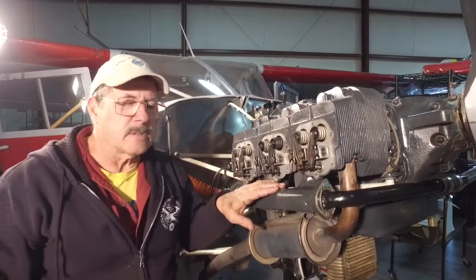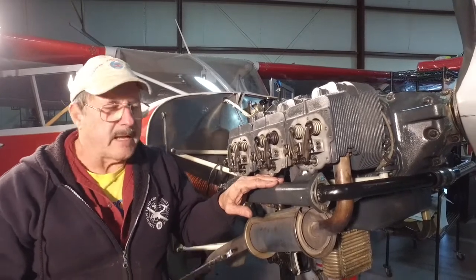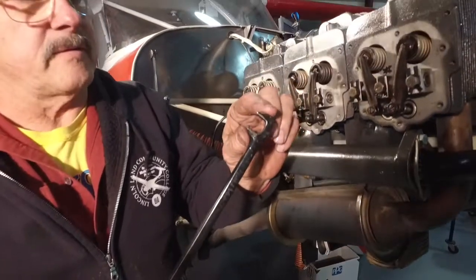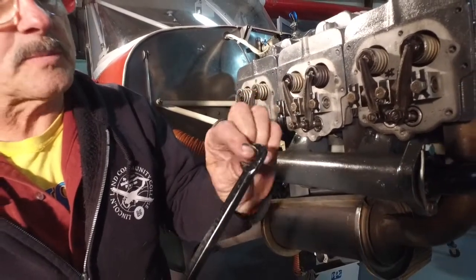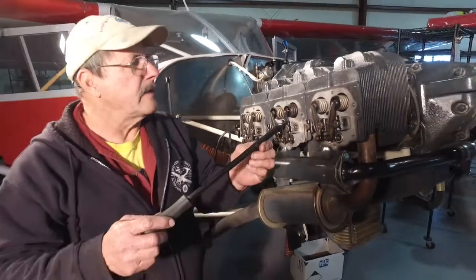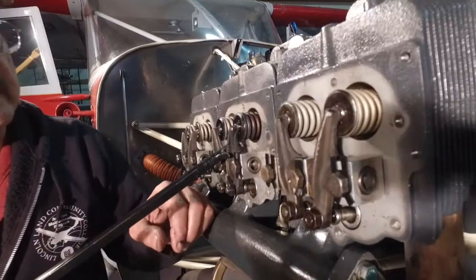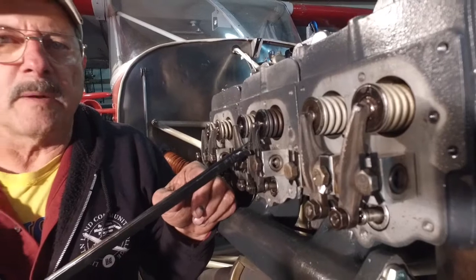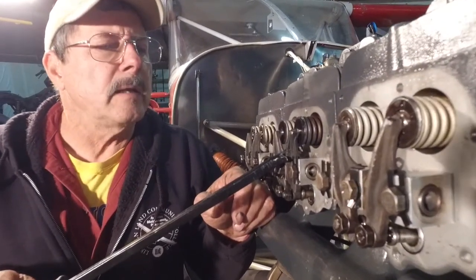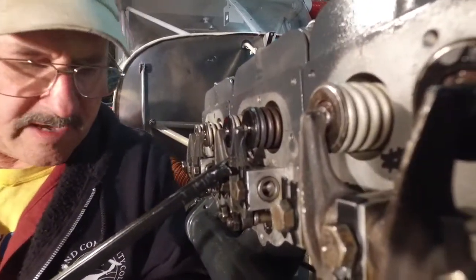The second thing is you have to bleed the lifters down to adjust the valves. I just made a simple tool here — it's just a little cheap pry bar, and it's a 5/8 wrench welded on the end of it. It's all smoothed off so it won't do any damage to the rocker arms. You simply hook it over the rocker arm like this, and if the engine's been running, the oil will be pumped up inside the lifter. So you don't have to pry hard — just gently, and you can actually watch the rocker arm come away from the valve.